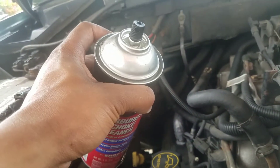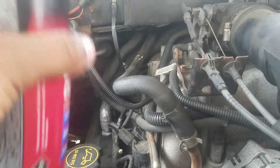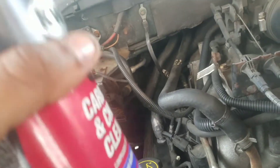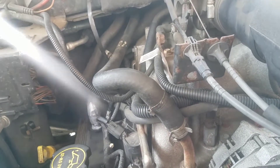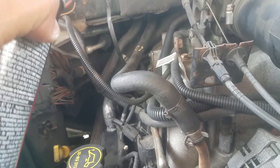The third method is carburetor spray, which is not always recommended but a lot of mechanics use it anyway because it's easy — though it's also pretty risky. If you use this too much, especially when the engine is hot, it's going to catch on fire. A lot of mechanics decide to use this anyway, like me. You basically spray it wherever the leak is coming from. This is originally used for carburetors or throttle bodies; you can also use brake clean spray. I did have a slight leak from this elbow right here, but once I covered it with duct tape it hasn't been leaking like that. Without further ado, let's get started.